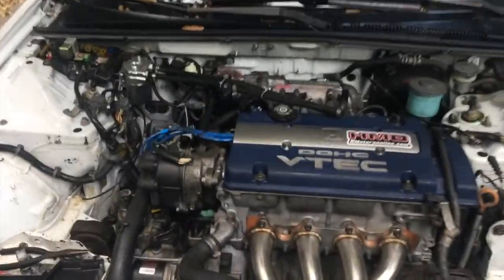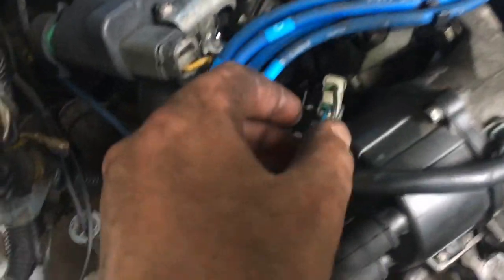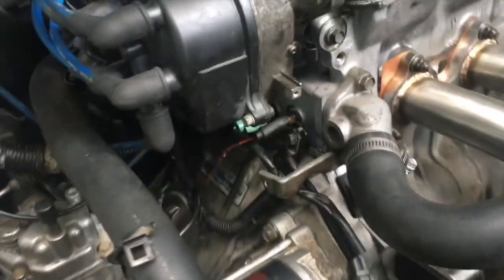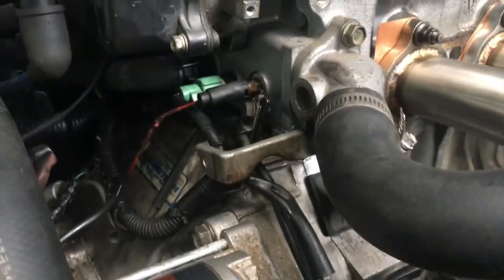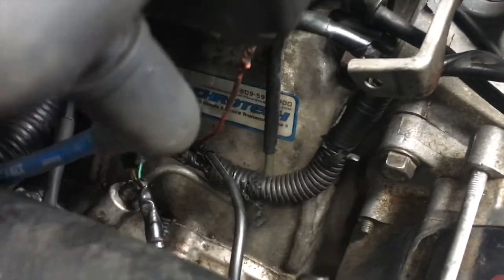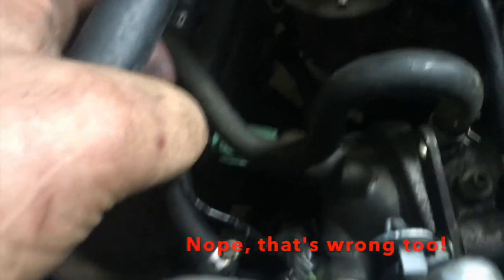It's the evening on the next day and it's looking much better now. I've got the wiring harness hooked up. One issue: two wires that hang off here go to one of the coolant sensors — I hope it's the one that's blocked off on the H23, but the rats ate it. I've hooked up one coolant sensor to the one next to the O2 sensor — the four-wire, low-voltage, narrow-band O2. For the other one attached here, I extended the wires and routed them back to the thermostat housing, which is much farther back on the H22 manifold. I think on the CB7 it's over here, so I need to reach a little bit.